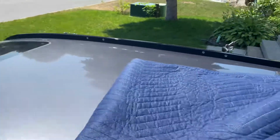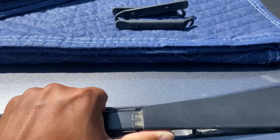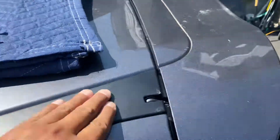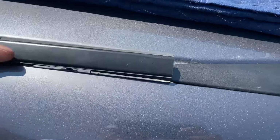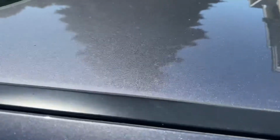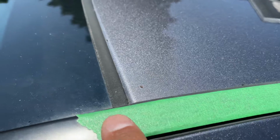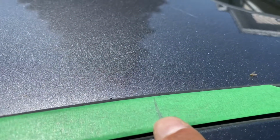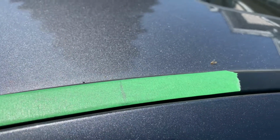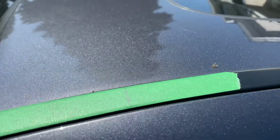So I've got the one side in. But literally, you could just lift it up, pop it out. That way you don't need to remove this back piece, and you're not weakening the integrity of this. And because you're throwing this strip out, once it's cut, it doesn't matter about popping the clips. So just measure 10 centimeters, mark it there, and I lift it up just enough to get my Dremel in and cut it right out. And then easy does it. The bar goes right on top and you just bolt it in. It is honestly that simple.